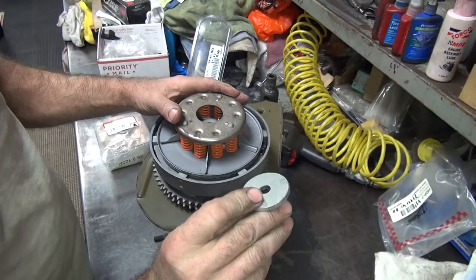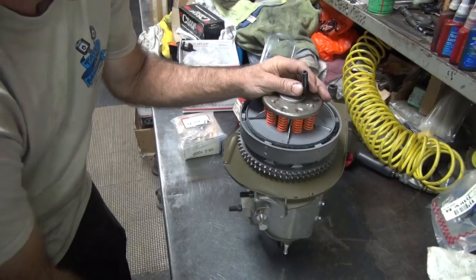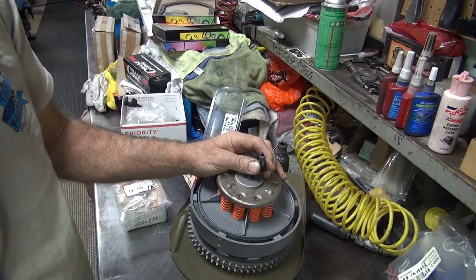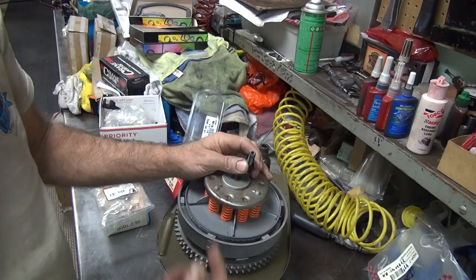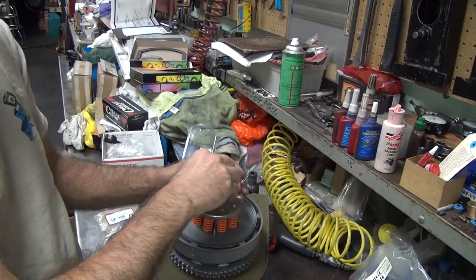Now, here's a special washer from Westcott Sales, but you can use a valve collar or some other washer. Here's your screw. Now you're going to put a little bit of grease in the end of that. Where's your Tribodyne at? You didn't think I'd do this with one hand, did you? Now, that end is where the throwout bearing goes in there, which we have not got cleaned up yet, because you failed to do your job. I'm not going to fail to do my job. See, I put it in there for you. Now you don't want a little dab on the other side? Oh, no, that's right. That's the threaded side for the flat blade screwdriver. And this part here?